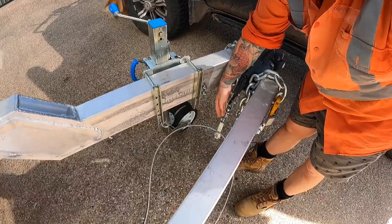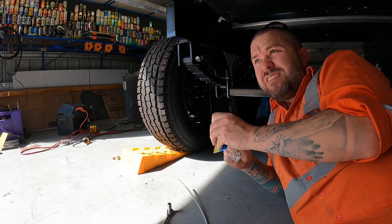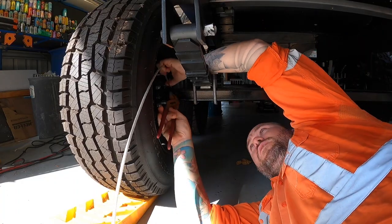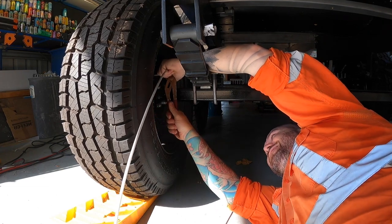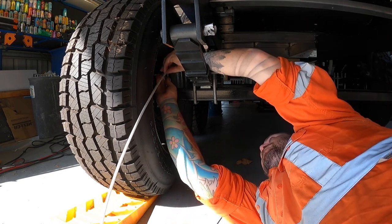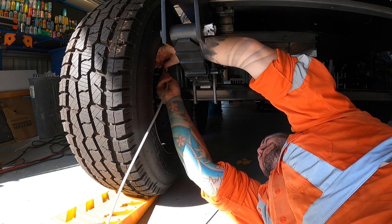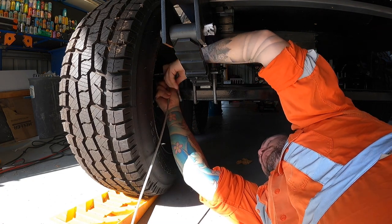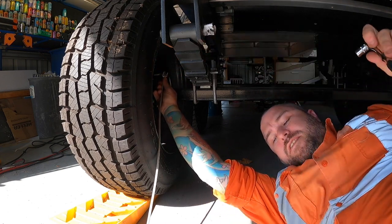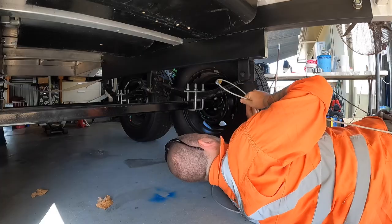It's got this guide down here, a little poly one, bolts onto the back of the handbrake. Ran that through there, doubled it over. Hopefully all I've got to do is put one of these on so I can drill and tap and mount it later. Put it on first — hopefully I can squash it a little bit, make it easier. Got it. That pinches it down pretty good, and I don't think that's coming off. Got heaps of cable left.